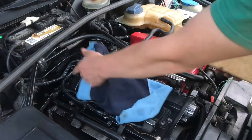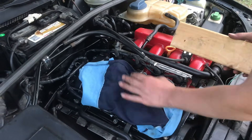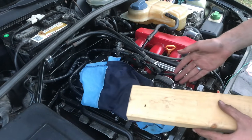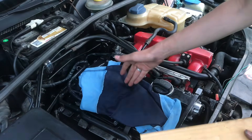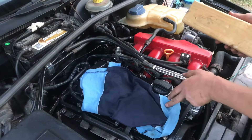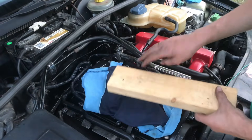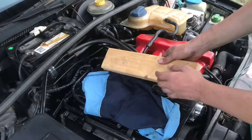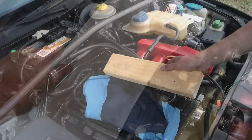When you have the fuel rail out, you want to either support it and/or cover up the coil packs here, so if the injectors were to come down and spray the coil packs, it won't actually spray them. We had that happen — we actually have a clip of it — whenever the injectors came down and sprayed the coil packs and it popped. So using a cloth and this piece of wood, we were able to support it up using a screw so it couldn't move down.